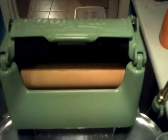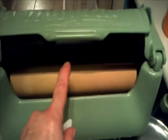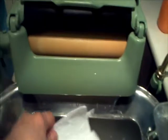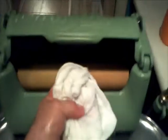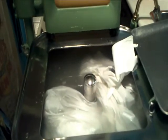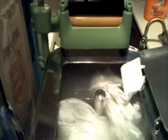For a shirt, you would position it so that the buttons face upward as you put it into the rollers. The reason is that the top roller on an old Maytag is soft and the bottom is hard, so the soft top roller protects zippers, buttons, and snaps from getting broken. You can see the clothes coming out the other side and down into the basket. That would typically be a rinse tub, but in an apartment I don't have room for rinse tubs. So I have to wring everything out, do all the loads of wash first, drain the tub, and then rinse back in the same tub. It's a bit of an effort, but it's fun — and it does a very good job.